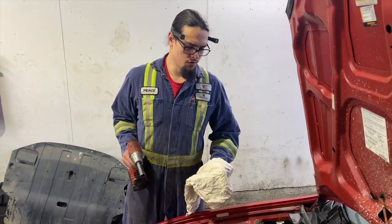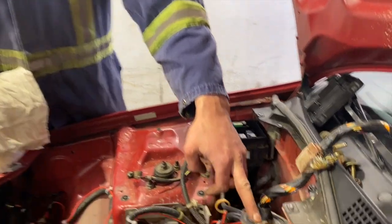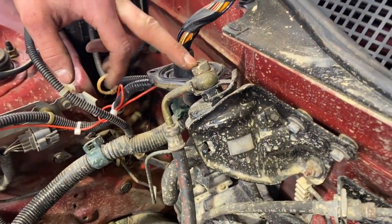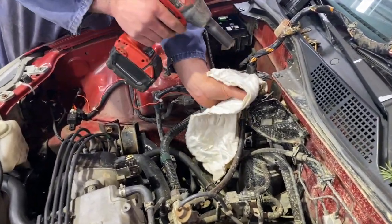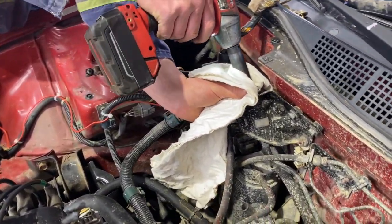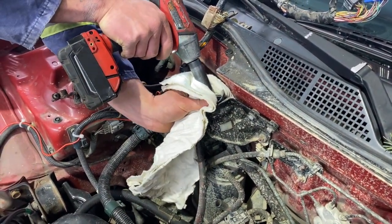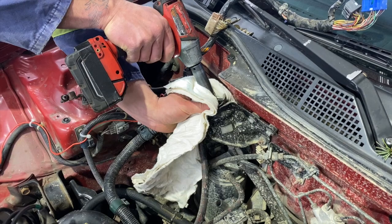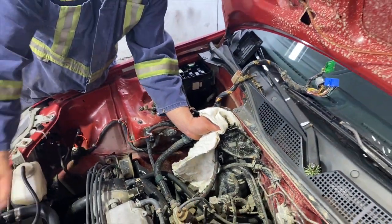Next, we're gonna go into the fuel system. I'm just gonna disconnect our banjo bolt up here for the fuel feed. They tell you to relieve the pressure. Let's find out how much pressure is actually in there. Just gonna cover it with a rag. Already bled out. Just a banjo bolt, a couple copper washers on that bad boy.